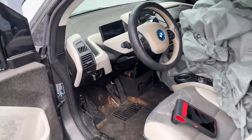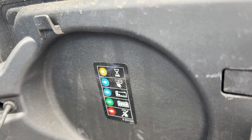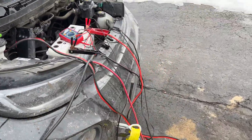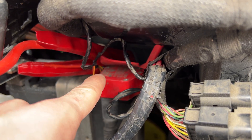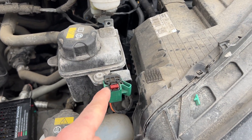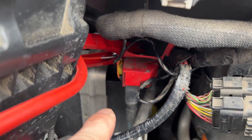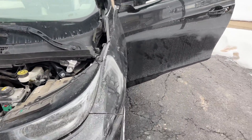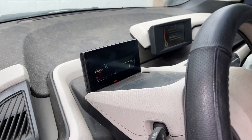I'm not 100% sure, but it definitely looks like it — because on the other side you've got the blue blinking light, which means it's charging. Yesterday it was just an orange or red light blinking. So how did I fix it? This little wire right here was unplugged and actually cut in one spot. So I fixed the cut and plugged it back in. I de-energized the high voltage battery before I did that by pulling it out so the high voltage battery was disconnected. Then I redid that part, reconnected everything, plugged it all back in, reconnected the high voltage battery, plugged in the charger, and I think it might actually be charging now.